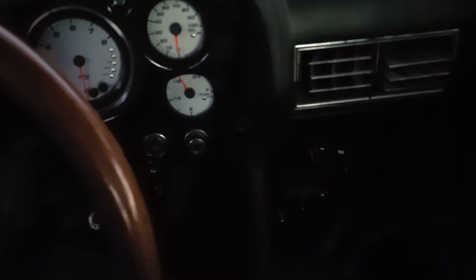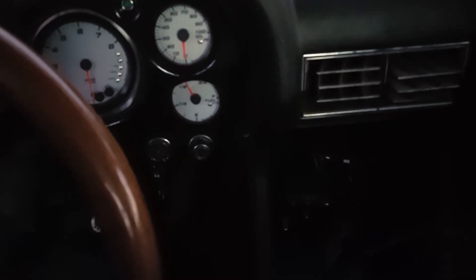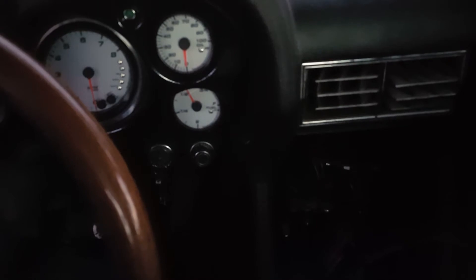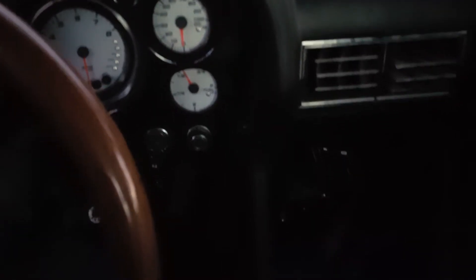I've been doing a little bit of tuning on the E85 because it didn't quite like to start the same. I've been playing around with the cranking fuel and I've got the prime shot not completely turned off but very low — it was 259 originally and I've got it down to about 60 right now.